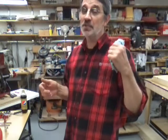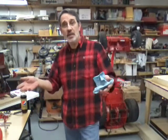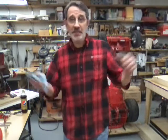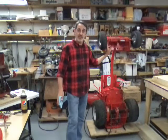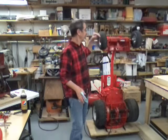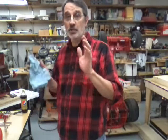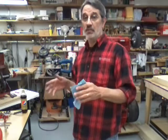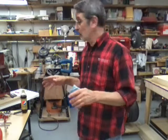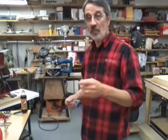Like I've said, this is my boss's rider. He said, hey, why don't you check a few things out on it and make sure it's in good shape. And if you want to, you can make a couple videos. Well, I'm hoping he meant I could tear this thing all apart because we ain't done yet. The next videos, we're going to be taking the tires off. We're going to be taking the kingpins out. And we're going to check what they call bearings, but they're really plastic bushings that your kingpins rotate on when you turn your steering wheel. Them are important. The Snapper that I've got, my 33-inch, mine are shot. And they're wore to the point where they've wore out my kingpins. And luckily I have another machine for parts because the kingpins are no longer available. A lot of these parts aren't for these old machines. You have to find a boneyard that's willing to sell parts. So that's coming up next.